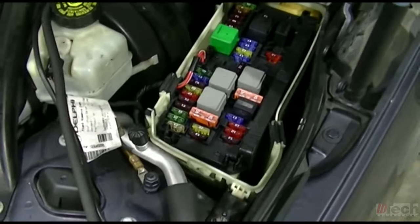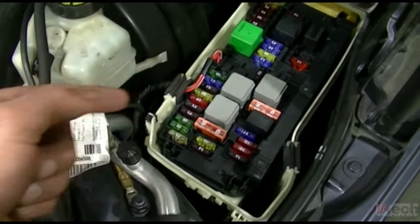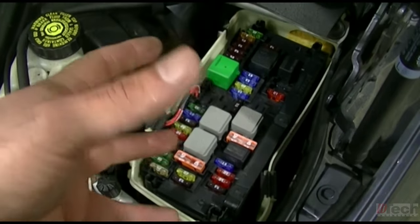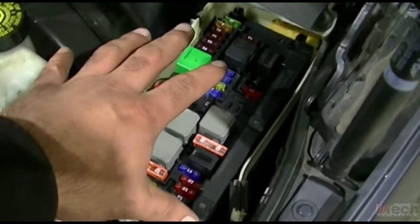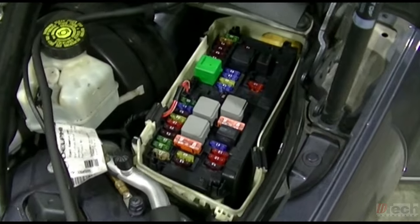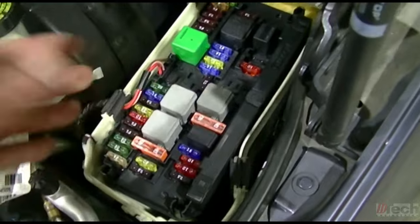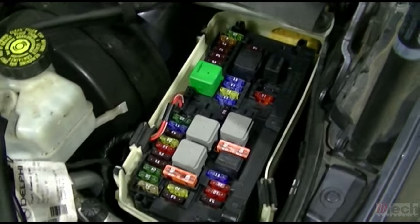Now, in order to do that last final check, to get to that wire that comes out of the SAM, it involves a lot of work just to make that final determination. To lift this out, it's quite a bit of work that's involved. I believe even the wiper motor assembly and the cowl, obviously all that has to come off to give you enough room to lift out of there, is what I think is the process for getting the SAM out.